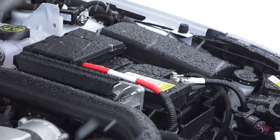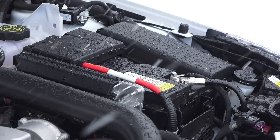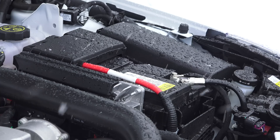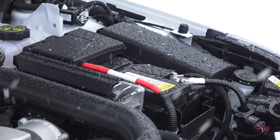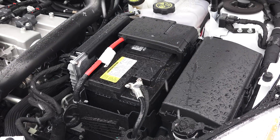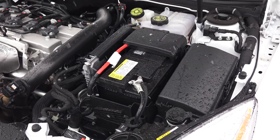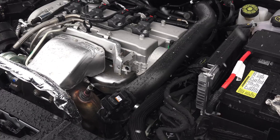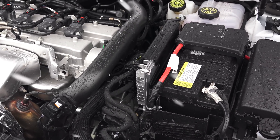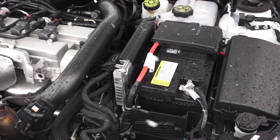What's important to realize is that a smaller battery may be sufficient in warm weather, but it may not have enough juice to power up an engine in cold weather. That's not to say that more CCA is always better, as larger batteries will weigh more and cost more. This is something you really only need to pay attention to if you live in a location with cold temperatures. If your battery is starting to get old, you may also need to consider replacing it, as it may not have the cold cranking amps it once had when you originally bought it.